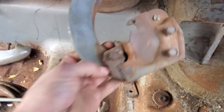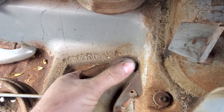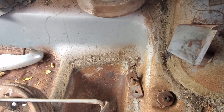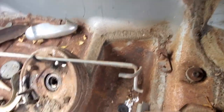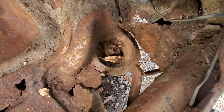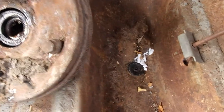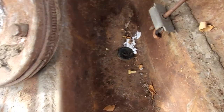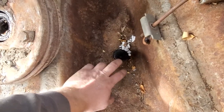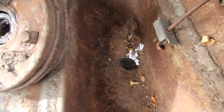Got the hinge sitting here. I probably won't use this hinge but I needed one of these pins here for the hood hinges, because somebody took my hood hinge springs off and then they wore out my hood hinges - so those are going to need to be fixed. You can see the floor in here is pretty healthy. The trunk floor is really solid from about here back, and the spare tire carrier is really solid.